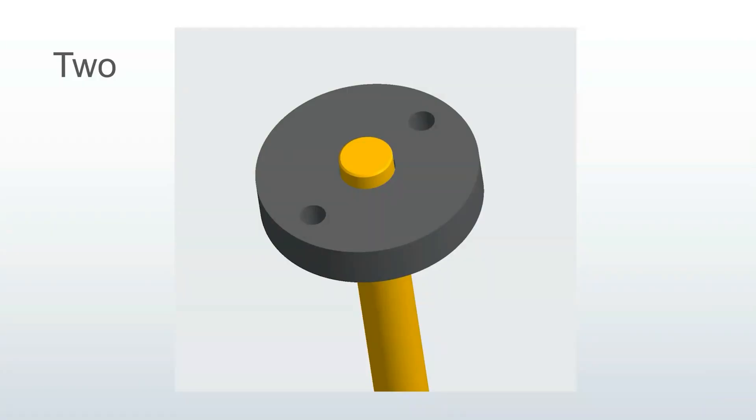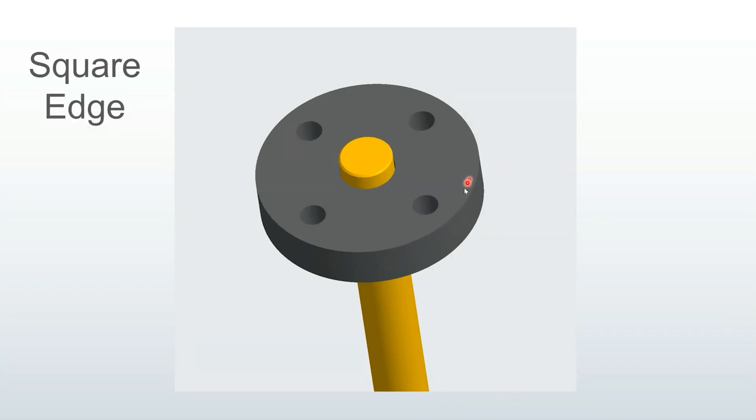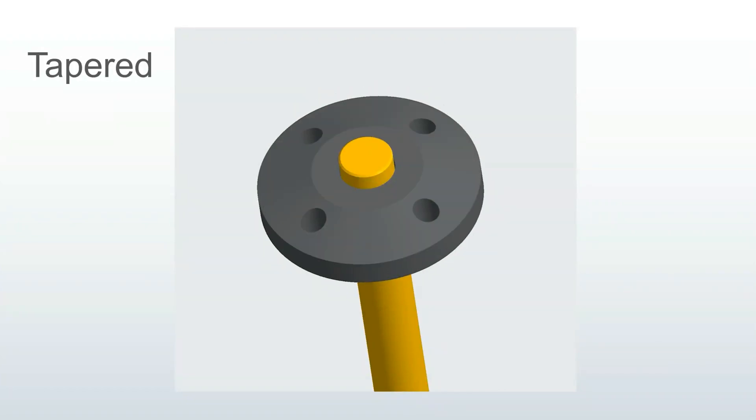Let's take a quick look at all the most common piston head damping tuning variables. You'll see piston heads with two holes, three holes, three smaller holes, multiple-sized holes, four holes, five holes, six holes. You'll see different thicknesses of the piston head. The edge of the piston can be a factor — they'll either be square, chamfered, or rounded. You can get tapered pistons, which have a taper on one side, creating a different response in compression than rebound.